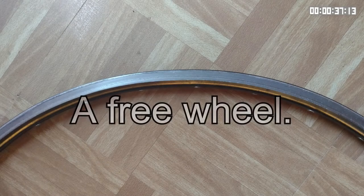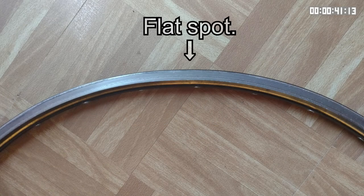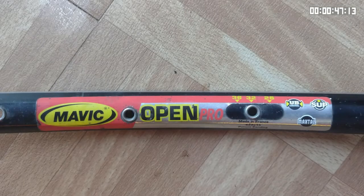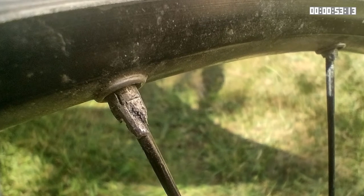I was recently gifted a wheel, but discovered that the rim was no good. I decided to disassemble it so I could rescue the hub. This wheel appeared to be built with good quality components, and that included the spokes. However, the spokes were held in place in the rim with aluminum alloy nipples. It was clear, though, that corrosion had been working on those nipples.